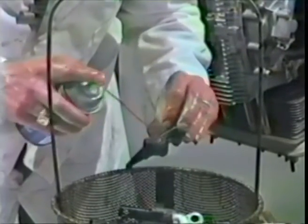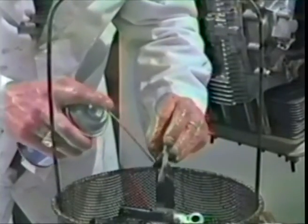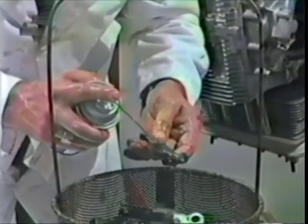There we go, now it's clear. And the exhaust rockers are generally in pretty good shape, though occasionally they do pit too, or they'll score on the inside. But these are all fairly decent. Now the intake rockers, here's one we treated. You do the same thing. Blast it out. You can rotate the adjustment screw usually sometimes to get better angles on things.